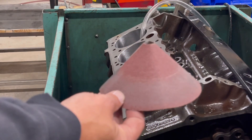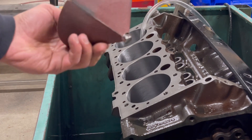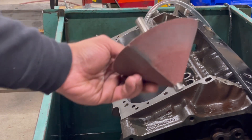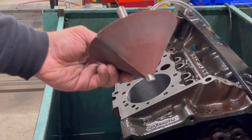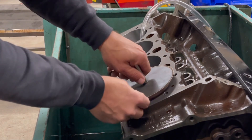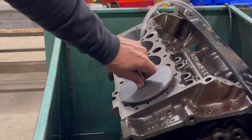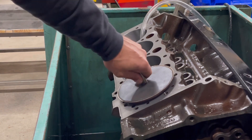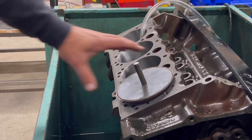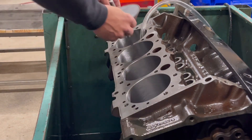This one here is a little bit worn, but it's still got quite a bit of use. Long story short, it goes on there just like that — it's 45 degrees. I think this is a five inch cone, so whatever bore size you're working with, it's going to work. What you end up doing is you put it on your drill, go in here like this, and spin it. That puts in that 45 degree chamfer. Since it's rubber, it's really not ever going to get out of round — it conforms to that. You turn this on with your drill, spin it a little bit, not a whole lot. This is a heavier grit one — you'd have a finer one to make it fine on the second step — and you just keep going down your cylinders with that.